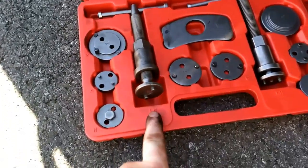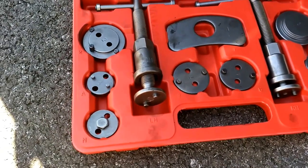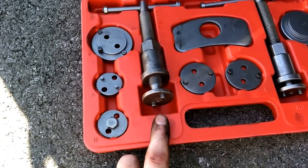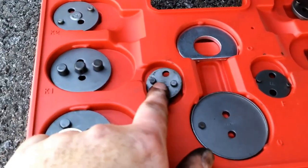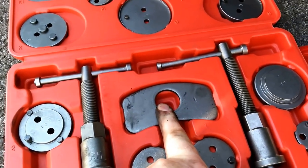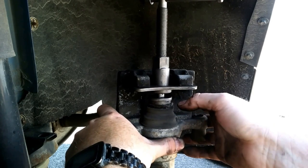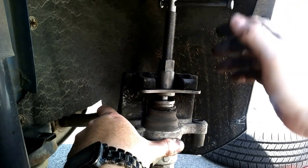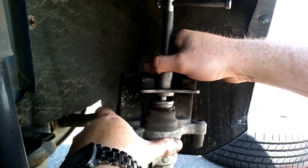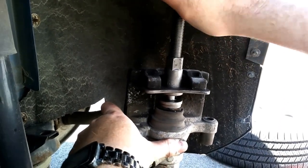In your kit you're going to see a left-hand thread and a right-hand thread — try not to get these mixed up. Left-hand thread means left-hand backs it out, and that's the one we need for a Ford. I looked up the instructions and it said we need the M adapter for a Ford of this era. Then you need the back plate to hold it in place. Slip it in, back it up until it snugs, and then just turn it clockwise until the caliper resets.